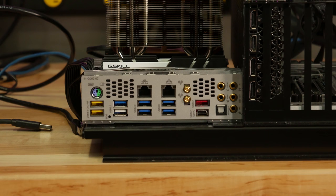We've got our two Gigabyte Amp-Up Audio ports — those two USB ports have a separate power delivery system for USB audio DACs, so they get clean power. The idea is that sound gets converted from digital to analog outside the relatively noisy electromagnetic environment inside your case. Then we've got eight more USB 3 ports: two are USB 3.1 Gen 2 (10 Gbps) — one Type-A and one Type-C provided by an ASMedia controller with PCIe 3.0 x2 — and the others are USB 3.1 Gen 1 (5 Gbps). One of them, the white-colored one, will let you flash the BIOS even without a CPU installed, so you can update to support newer CPUs like the 1900X.